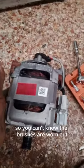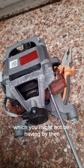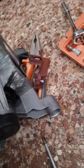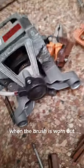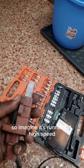Checking the motor, there is still soot on it. You can't know if the brushes are worn out unless you check with a multimeter, or you remove the screws and there we go — very short. How does it spark? The carbon brush casing is metallic, so when the brush is worn out, the metallic casing touches the armature. That's metal to metal. Imagine it's running at high speed — spinning at around a thousand revolutions per minute — metal to metal. That's why you see sparks on a washing machine that uses a drive belt.